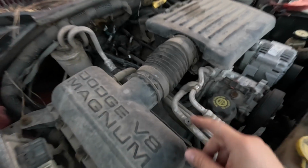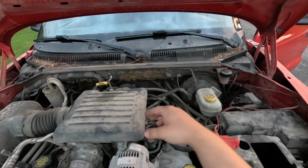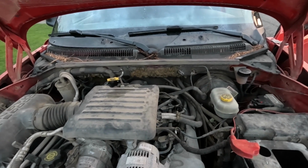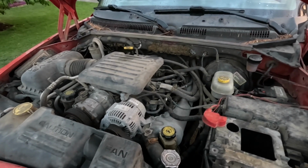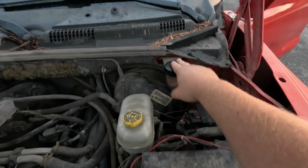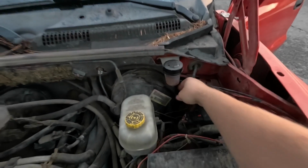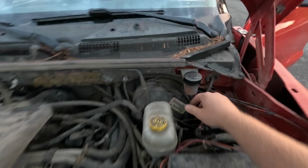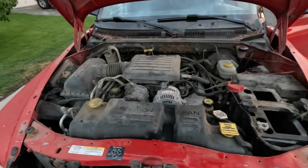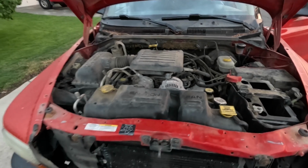I'm going to have to make engine mounts, going to have to fabricate that, but the transmission cross member that's on the NV3500 will actually mate up to the exact same transmission mount as the NSG 370. So it's a pretty good start to a build. It has the clutch fluid master cylinder here. The slave cylinder will actually bolt up to the NSG 370. So all in all, for $1,000, it was worth it to have these parts already installed on the truck.